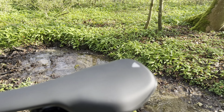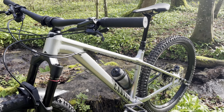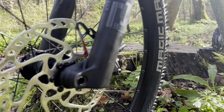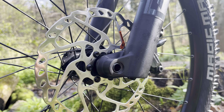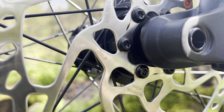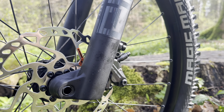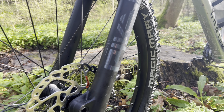The seat is horrible and super uncomfortable — gotta change that as well. The real deal breaker for me on the small size is the brakes. Although everywhere on the website it says 200, 240, or 230 millimeter rotors, on the small size you get 180mm and you cannot stop that bike. You get four-piston brakes, which are great brakes, but they basically never give you enough power with that rotor size.